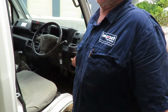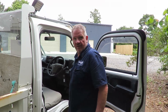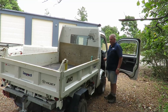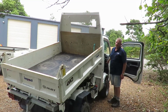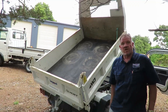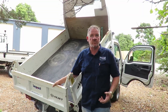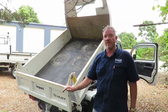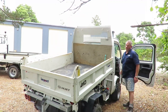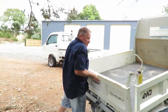I'll show you the second way the tailgate works. If you want to do any spreading of gravel on your races or similar, we simply don't unlock the tops. We raise it up and as you can see the tailgate is now opening from the bottom — just like a normal tip truck. You can put chains on these to control the spread of gravel, scoria, or whatever else you want to tip off. This is also the time where you can actually remove the tailgate totally — I'll lift these up and it's gone.